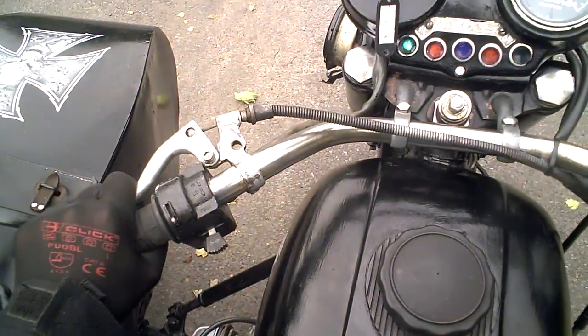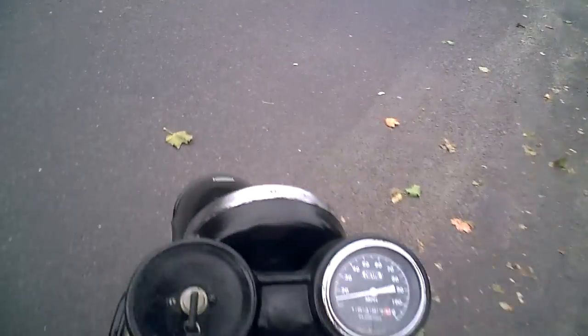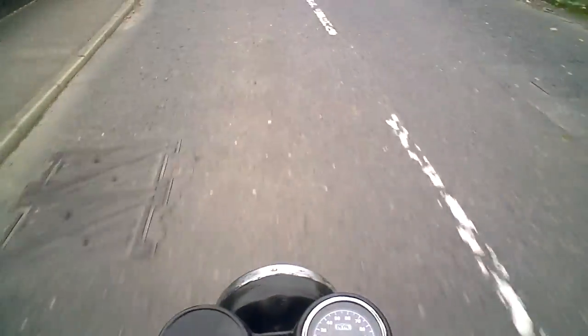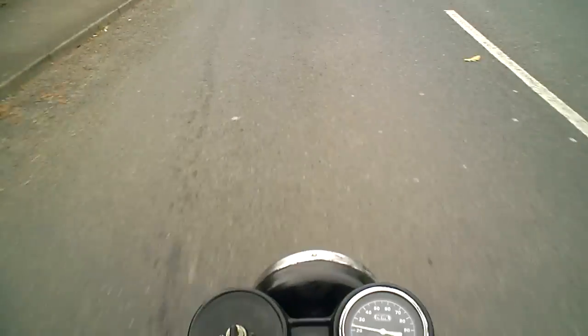The first thing I'm going to do is run through the brakes and that kind of thing. So up to the junction first. Just want a little bit of rear brake. I can feel from that the rear drum feels nice and round. And the rear brake feels pretty poor I would say, but probably past the MOT. Aspect is as it should be.